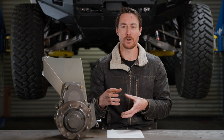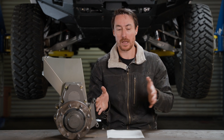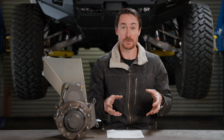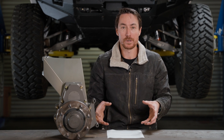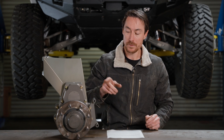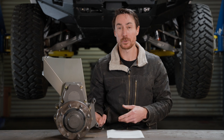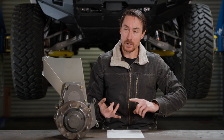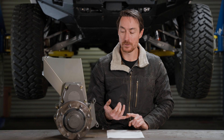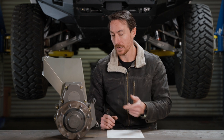I wanted to go away from the Unimog gear set, which had the gear and the final drive spindle all in one unit. Since I wasn't going to forge that myself, we ended up going with a Spyder Trax unit bearing. The reason behind that, as opposed to just a Super Duty bearing, is that Spyder Trax uses different materials for the spindle — it's just an item that doesn't fail. You still see guys in Ultra 4 race on this same bearing pack.